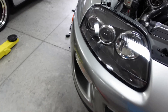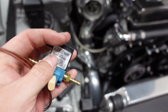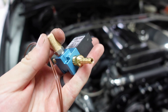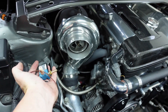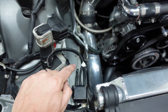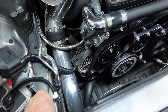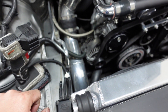One thing I wanted to show you guys too is we're going to a two-wire Mac valve, and it's crazy — there was actually eight wires to control the old HKS electronic boost controller. This newer Mac valve only uses two wires versus eight. The old one needed a vacuum source from the engine itself; this one does not. It has its own little filter and pump for the vacuum source. Colton's actually making a bracket for it right now. He currently has it tapped in with his blow-off valve, so now the blow-off valve will be its own dedicated line. We are going to reuse the hard lines he currently has.